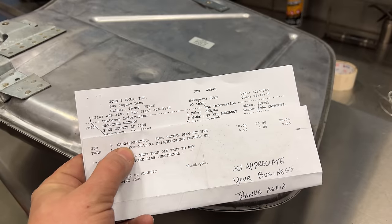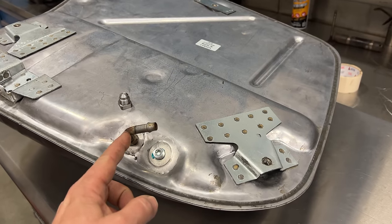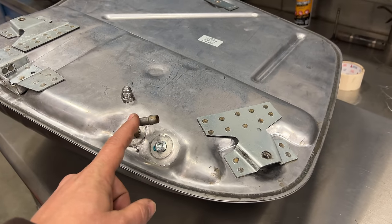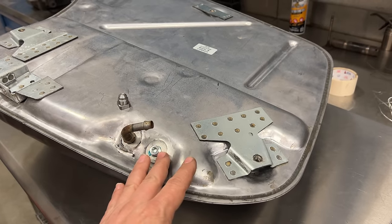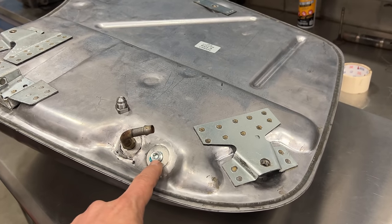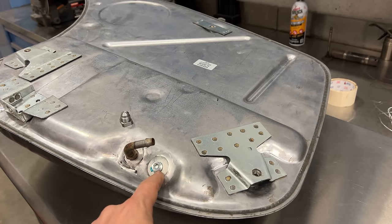You can see the part number is CAC2439 Special. If you look up CAC2439, it actually comes up with this part right here — it's a little tiny pipe that was used on the later XJ6s, and this pipe should solve my problem. I can install this, then put a hose here that runs to my pump. The main problem is these are not made anymore — nobody has one, and it took me a long time to track one down. I talked to Moss Motors where I got the tank, I talked to Welsh and other distributors in the UK, and nobody could give me anything that adapts to these tanks. I never did figure out what the thread on this plug is. What I did is take some fuel-safe sealant and cross-thread this plug in there. This port here was the fuel return on later Jaguars, and it returns the fuel at the very top of the tank, so behind this fitting is a pipe that runs up to the top. So I don't really have to worry about fuel getting into here.